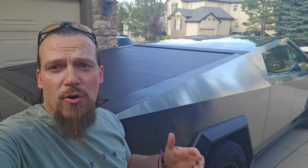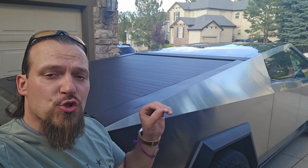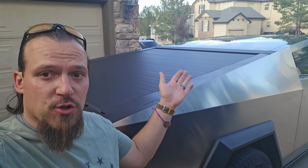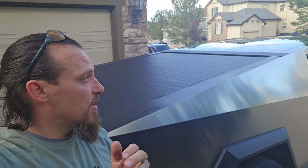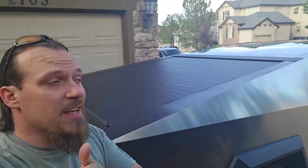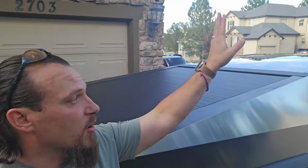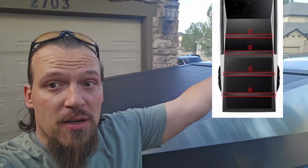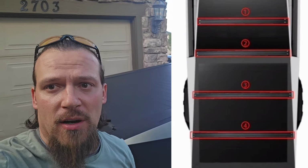You would figure this out on your own pretty quick, but right hand is as if you're driving the truck. So it's on your right hand side, the passenger side, then obviously the left hand would be the driver's side of the truck. Now if you notice, the crossbars themselves are incrementally getting larger. The smaller ones are going to go towards the front, which they're labeled as 1 in the box. So right hand 1 would be the front right passenger side of the truck.